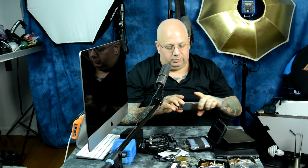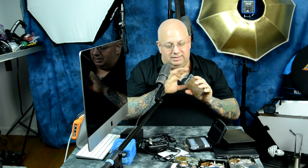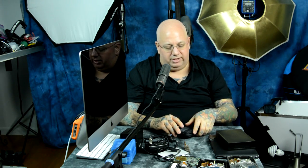Here's the world's thinnest hard drive — these are actually quite rare and still under current production. It's a Seagate hard drive, only 5 millimeters thick. It's a 500GB drive — there's only one platter in there with 250 gigs on either side. 250 times 2 equals 500 gigs. Here it is in an electrostatically safe case with a copper plate on the bottom, which I did myself. That is the world's slimmest hard drive at technically just under 5 millimeters.